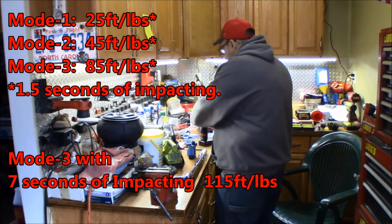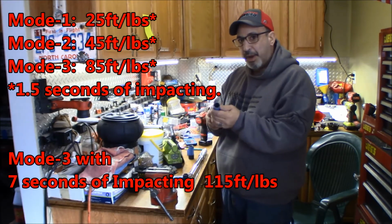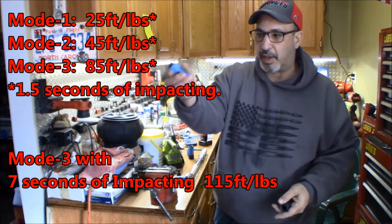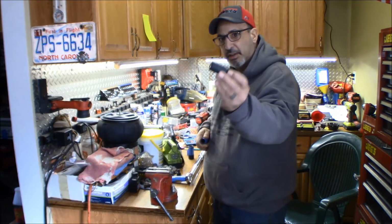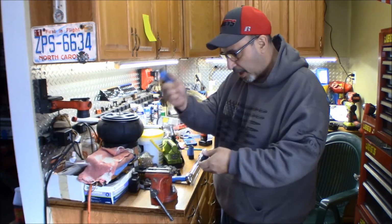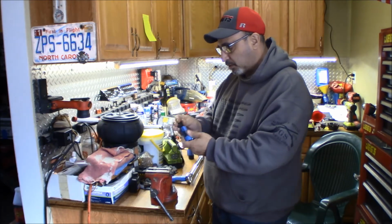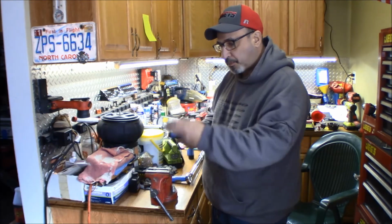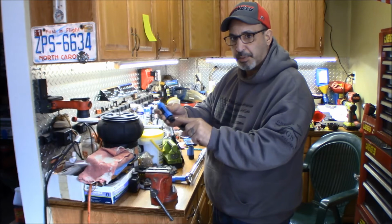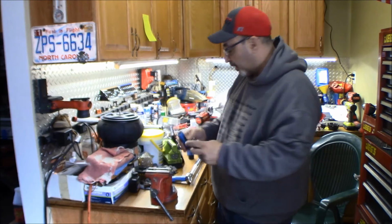So what did we show? We showed that lightening up the socket compared to this socket, right? A standard half-inch drive, 3/4 inch impact socket, and a standard 3/8 drive, 3/4 inch impact socket. There is a weight difference, okay? The half-inch is heavier. But we killed torque with this, so the mass difference in this setup compared to this one is the same as the torque loss that you might experience using the adapter, because our test results with these two are identical.